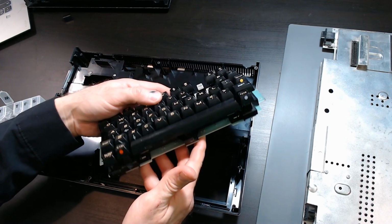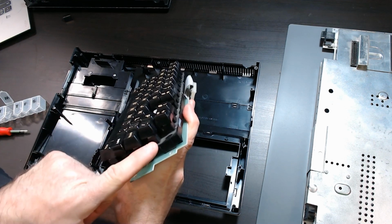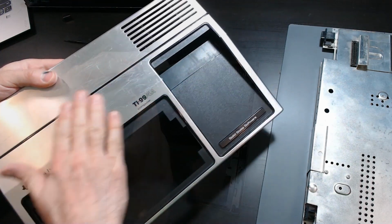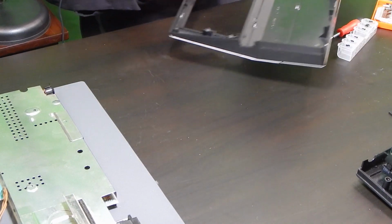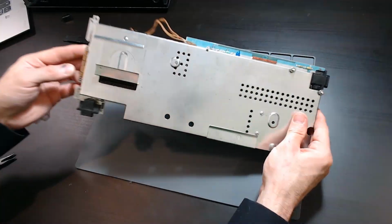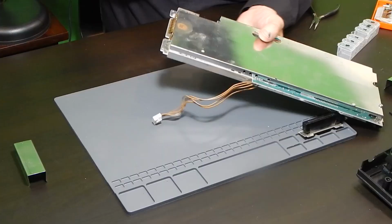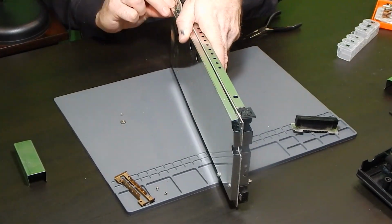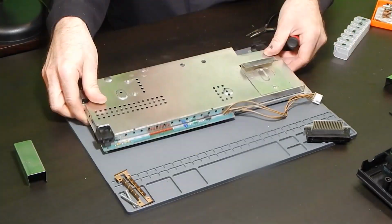Now we're going to keep going and open up that main board and take a look, and we're going to use that as an opportunity to correlate a little more to our story here about the TI-99-4A. Besides the TI-99-4's strange keyboard, there was one other issue that plagued it and the TI-99-4A still. While they were known as the first 16-bit home computer and having a fast for the time 3 MHz clock speed, the architectural and packaging issues of that TMS9900 CPU resulted in a computer that was slower than its potential and more costly to manufacture.